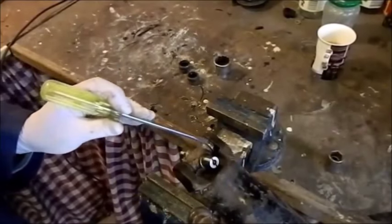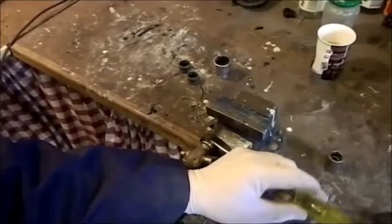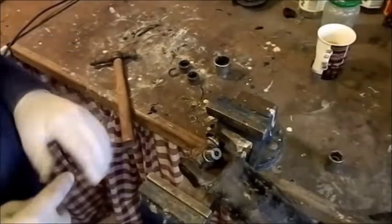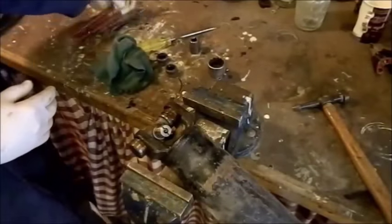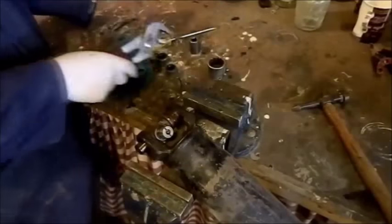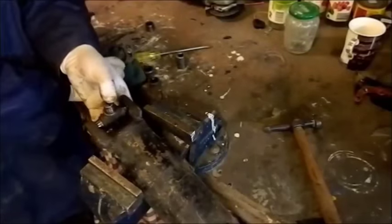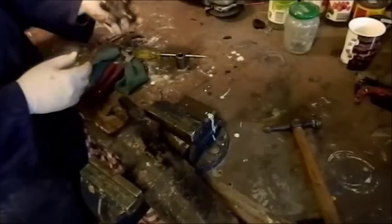I'm going to go with this tail shaft — I'm confident it's the right length. I've just got it on the trestle table here and I'm rolling it around to make sure it's rolling true, which it is. You'll soon pick up very quickly if there's a bent tail shaft because it will roll unevenly. To pop out these securing clips — there's one there and one here — you can sort of just knock them with a screwdriver and flick them out. Then using a couple of sockets we can sort of squeeze it out and release the cups, and the uni will just pop out. So I'll go and get some new unis, give the tail shaft a nice paint job — we know that's the right one for the job.